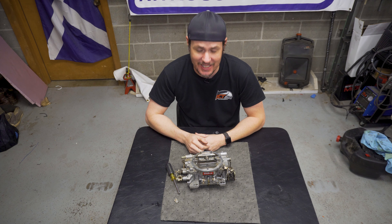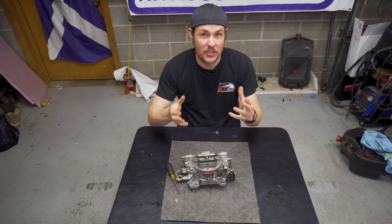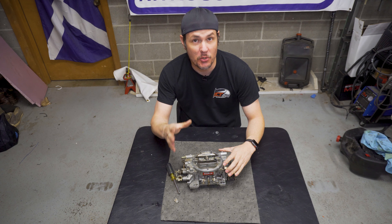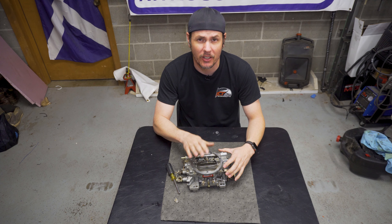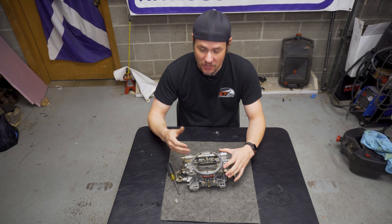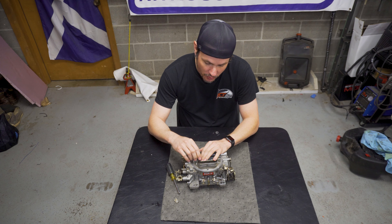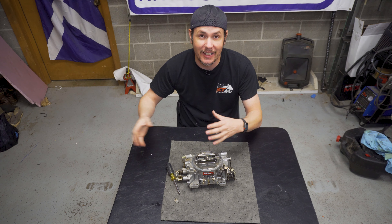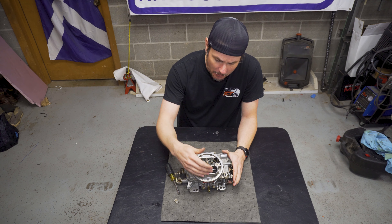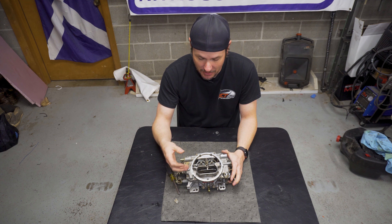This is much like what we do in EFI when we say we're measuring this much amount of air and then we need to enrich it or lean it out — and we do that by looking at AFRs. Guys don't really use AFRs to tune carburetors, but you can. There's no reason why you can't put a wideband on a carbureted car, get a wideband reading, and use that to tell whether you need to go up in jet size or adjust your metering rods to get more fuel. On a mass airflow setup, we correlate airflow directly into pounds per hour of air flowing through the intake tract to match the amount of fuel.